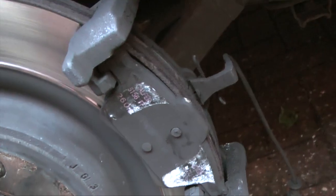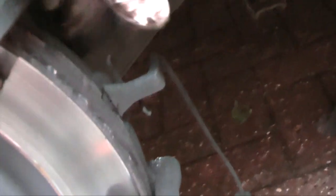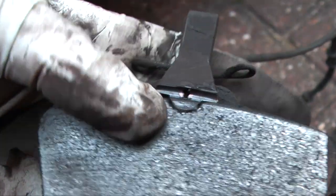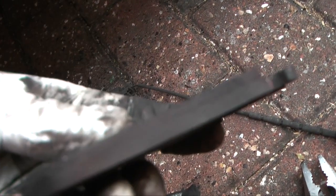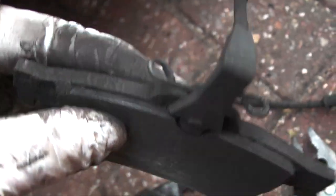Once you've got the caliper away, you can remove the brake pads from the carrier very easily. It's the one with the spring at the back, and in this case it also has the wear sensor on it. The wear sensor just indents there and you can see the edge of the disc has worn into it. There is a little bit of a lip on this disc because it's at the end of its life. There's still a little bit of life left in that pad, but the lip on the disc has worn away the brake pad low indicator.